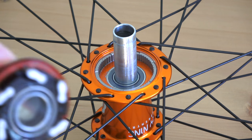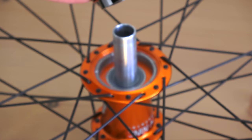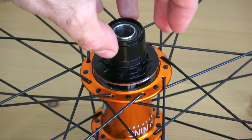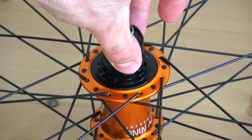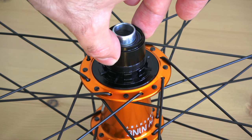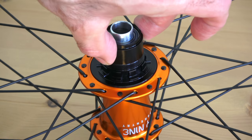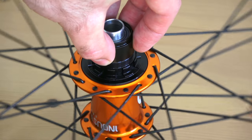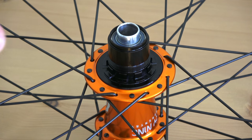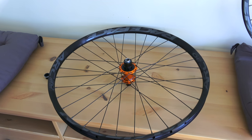Now we're going to slide this drive right back on — it just slips right in there. This one is brand new so it's all lubed up and ready to go. Gently slide that in, spin it a little counter-clockwise to get those teeth lined up, and you'll hear that beautiful sound as you spin it every 3 degrees — which is literally nothing. It grabs on and gives you that forward momentum to spin the wheel. Now we'll put that back together, get everything set up on the bike, and give them a full spin so you can see what they really sound like in action.